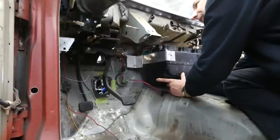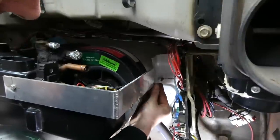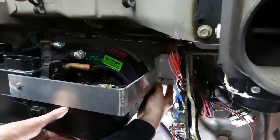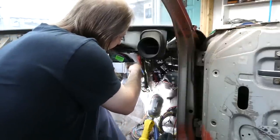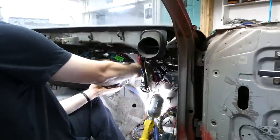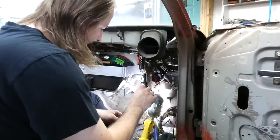Now this is going to be a lot easier to do now that one side of this is held in place. For the right side, I cut another piece of aluminum angle, and the idea is that once it's trimmed to the appropriate length, it will butt right against the rest of the bracket. Now this is extremely difficult to measure because I need 3 more hands to hold this thing in place, but I'm just trying to get the distance between the firewall and the bracket while trying to keep this reasonably square. Looks like about 45 millimeters.